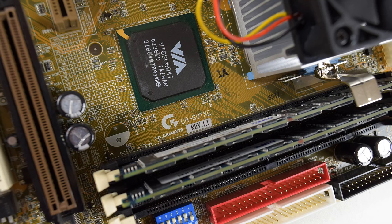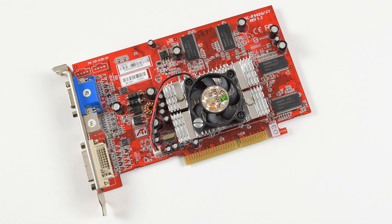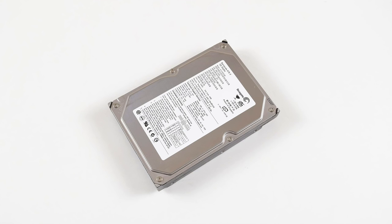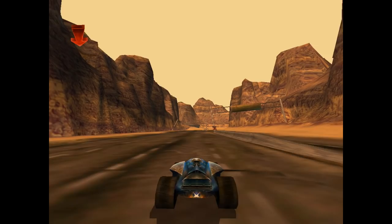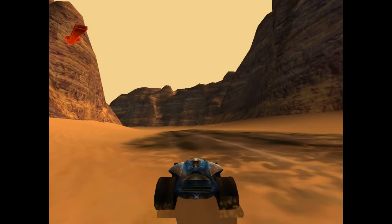For Intel we have the Gigabyte 6VT-XE with a Pentium 3 600 and a gigabyte of SDR memory. I didn't actually have a Pentium 3 600, so I used the 800 MHz model and downclocked the front side bus to run it at 600 MHz. Other shared components include a GeCube ATI Radeon 9600 XT, a Sound Blaster Audigy 2 ZS, a 120 gigabyte IDE hard drive, an IDE DVD-ROM, and a Corsair VS450 power supply. The OS is Windows XP Home Service Pack 1, using the latest VIA drivers, DirectX 9c, and ATI Catalyst 5.2 drivers. Disk imaging was used to re-image the same hard drive to keep comparisons as fair as possible.